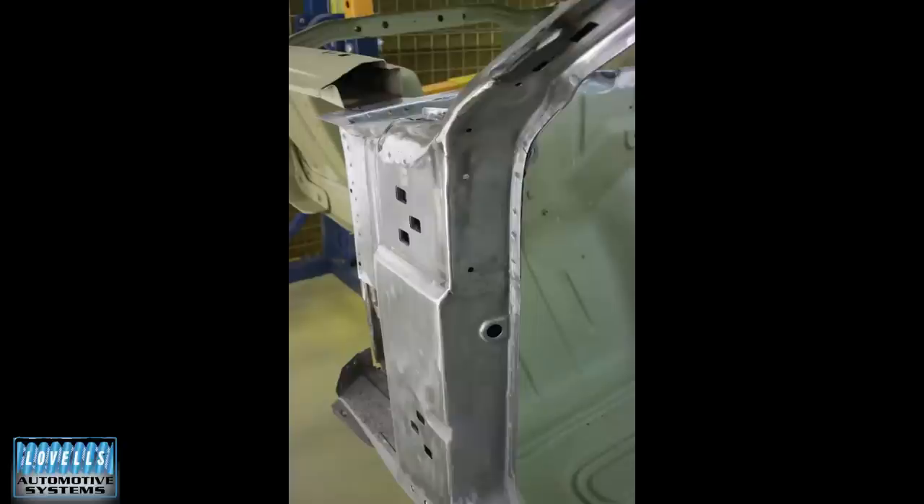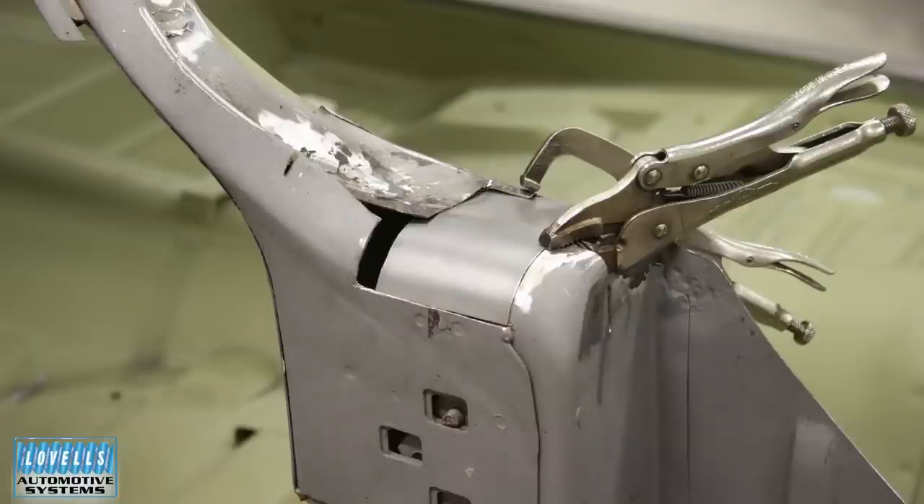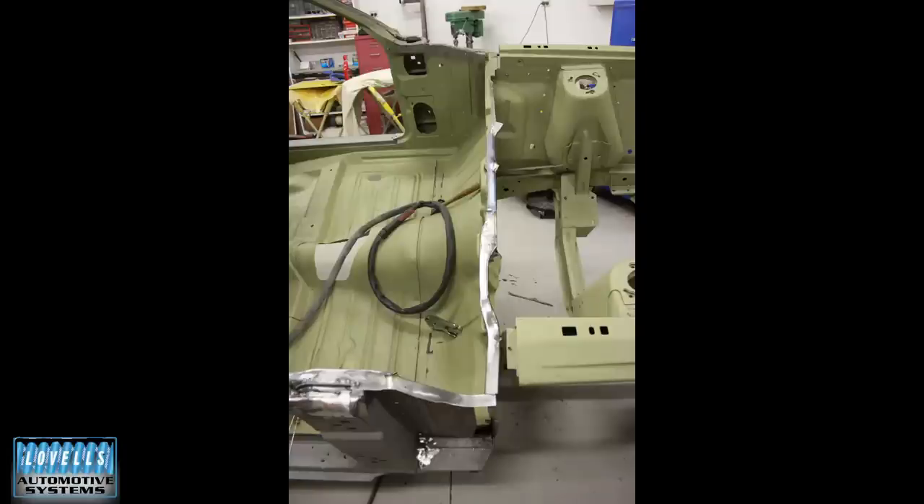We get some epoxy, and there's a nice shot of the top of the A-pillar. I was talking to a guy the other day looking for A-pillars and told him you're just going to have to unpick it and make the bits as you go. We made a fairly early decision that the roof had to come off because it needed gutters and things. I normally pull it down and start fabbing up the bits, do the weld and grind to get the top of that A-pillar. You can see just starting to come around on the top of the firewall — that's where pillarless coupes come from with all this work.